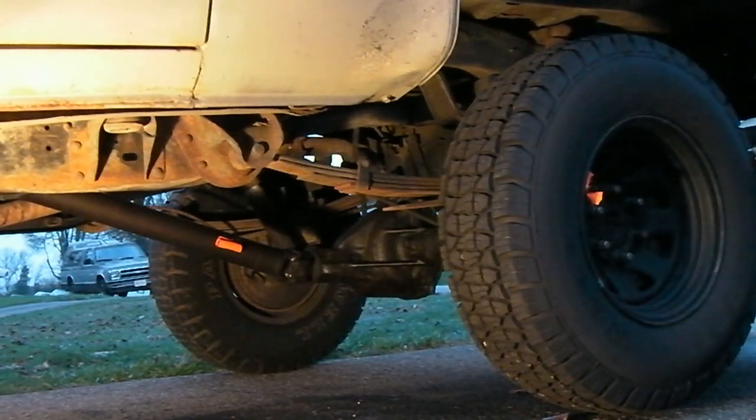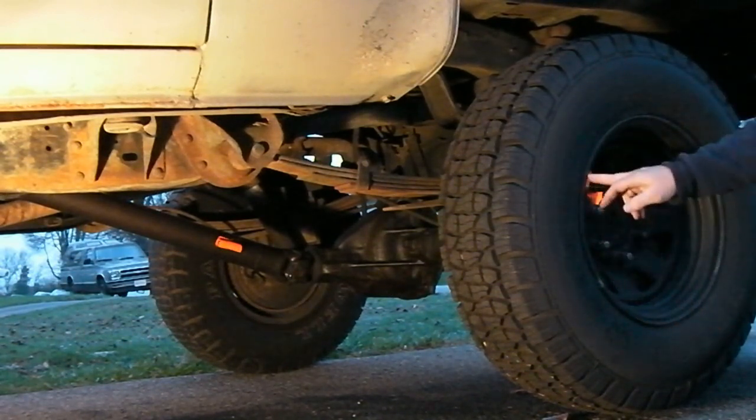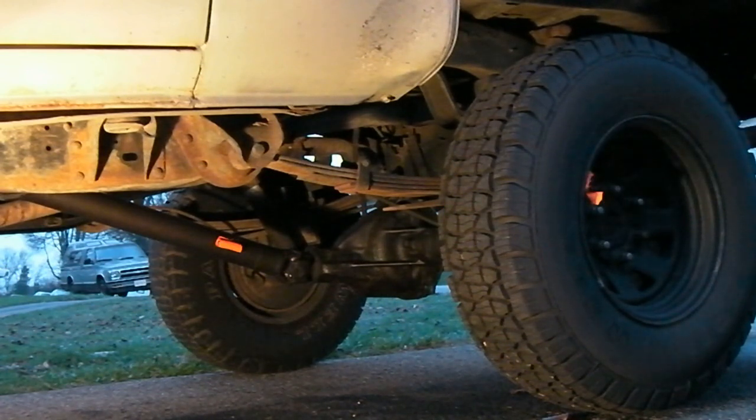We're back. From here around that's one, and up to here that's probably 0.3 — so 1.3. The tire turned approximately 1.3 times for two full revolutions of the driveshaft.